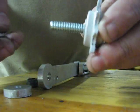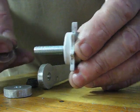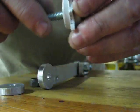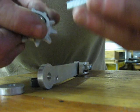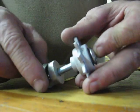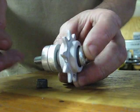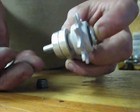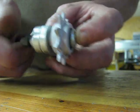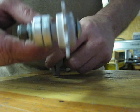There are a lot of ways to move this idle tensioner in and out. You're gonna have plenty of screw here too. If you have to buy more washers to move it out, I don't think you will — this little setup is sufficient. When you put the washer on, either the step side or the flat side is usually sufficient to adjust it. You can move it somewhat on the frame in and out, but you don't want it angled — you want it nice and level.